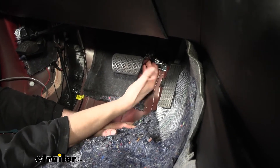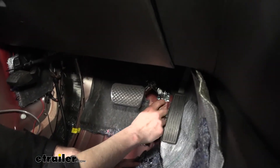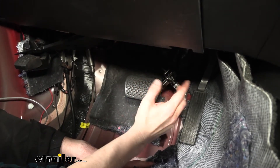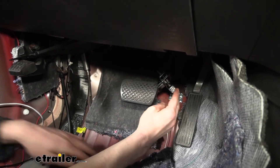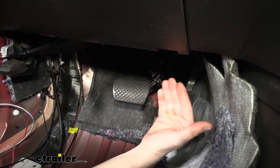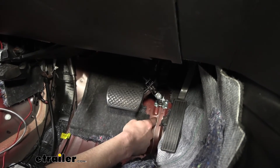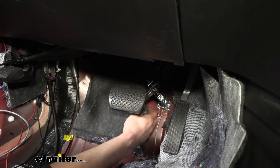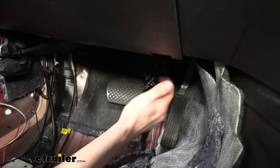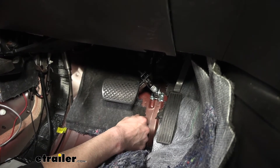The bare cable coming out of the sheathing runs up to a pulley mounted near the brake pedal arm — not the pad portion, but the vertical arm. The cable attaches to a clamp that goes around the pedal, using bolts and nuts from the kit. The cable end has two adjustment nuts to set tension — closer or farther away. You slide the cable into the bracket by removing the inner nut, slipping the cable in, then reinstalling. Leave just a little slack so there's no constant pressure on the pedal.